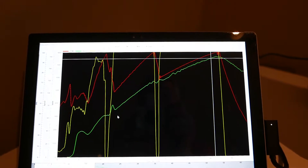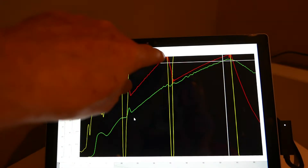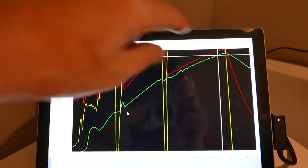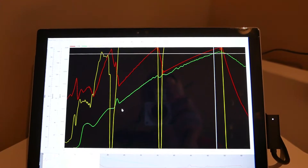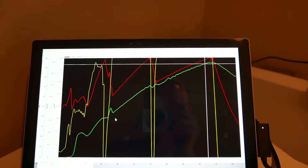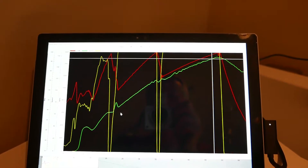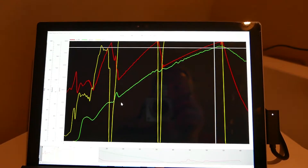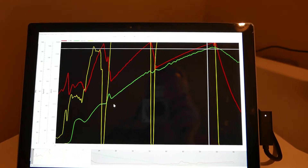That's why it's 13.8 instead of 12.8. I go through and hit the rev limiter in second gear — it dips twice there — and I hit the rev limiter three times at the top of the track. The first thing I need to do is put a solid motor mount in, because you can see from the video that the tires are chattering off the line. The engine is rocking back and forth, and there's evidence in the engine bay of that, which keeps you on and off traction several times a second. Solid motor mounts will solve that problem — I just didn't have time to put them in.